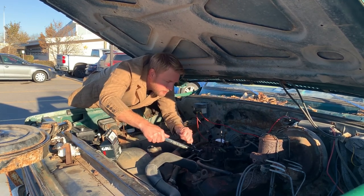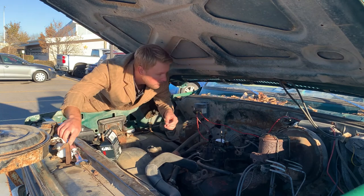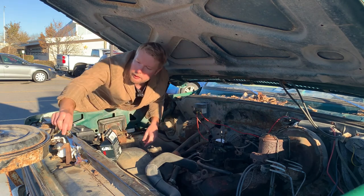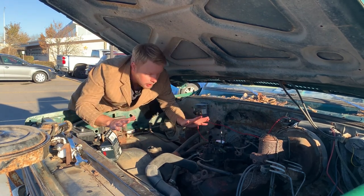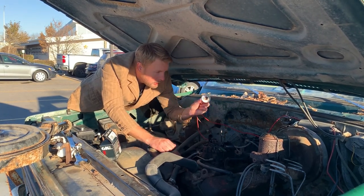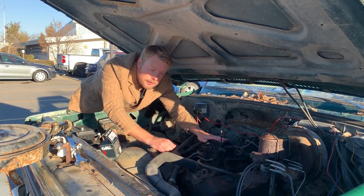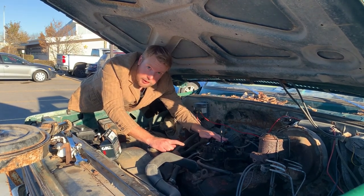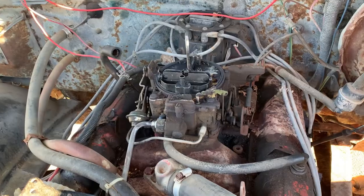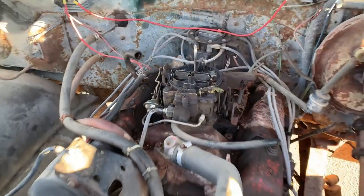Let's just do that. Okay, yeah. All right. So, the old fuel filter was just plugged. So, got a new one in there. Hopefully that's that, and maybe we can limp a little further here. I love to run a little Teflon on all my lines because everything I touch just leaks. So, we're gonna start it, check it for leaks. Well, seems to be leak-free, but carb anyways, and not fuel line.